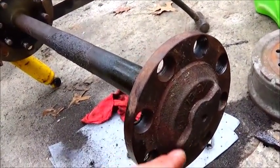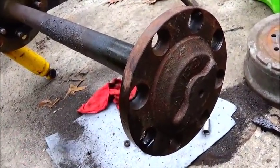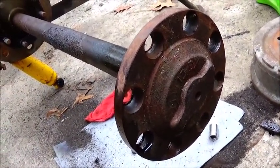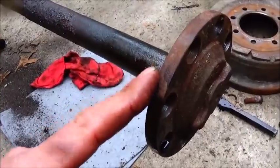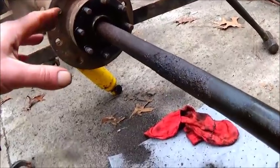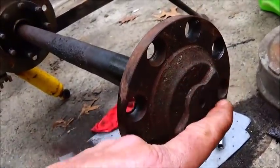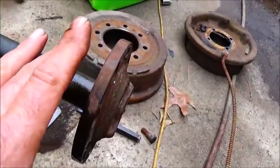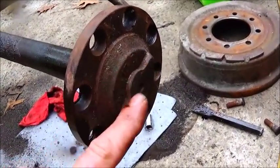And we'll probably do a good hard press fit where we may have to freeze the axle and heat the outside, and we'll actually put it on and dial indicate it in, keeping it chucked in the lathe, and get it good and straight. Once it's good and straight, I'll slide it back in, everything dry, put the bolts in it, and then we'll come around the outside of it and put a really good weld on it. And we're only going to weld the outside. If you weld the inside, it tries to pull and you get some warpage. But if we get a really good weld on the outside of that, it won't go anywhere.